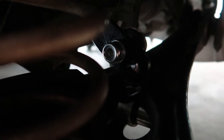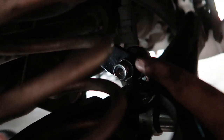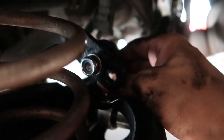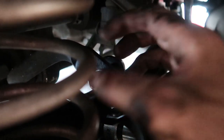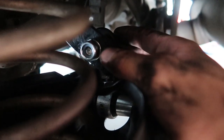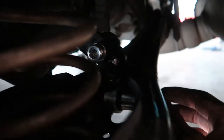This is all pretty easy — the nut faces you, this is a spring, it goes like this on both sides with the nut toward the spring bottom. The bushing is towards the back of the car. I think I said 12mm earlier but it's actually 13mm on each side. Put it through the sway bar first and then through the bottom. With no weight on the wheels I can rotate this back and forth a bit. Everything is loosely installed for now — if I need to adjust, I'll take off the top one, rotate it up or down one or two turns, and try again.